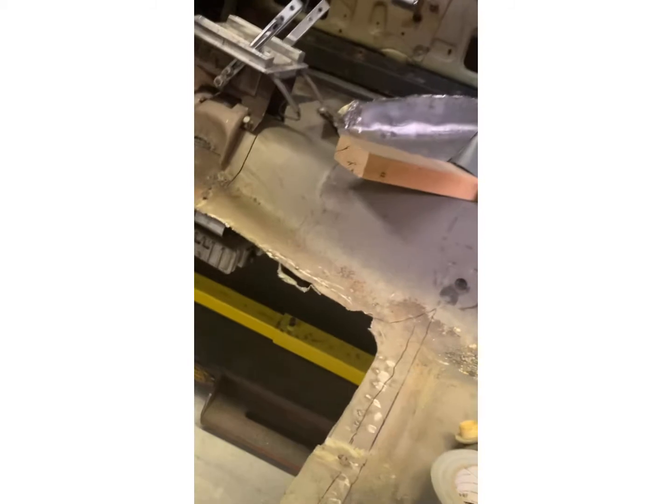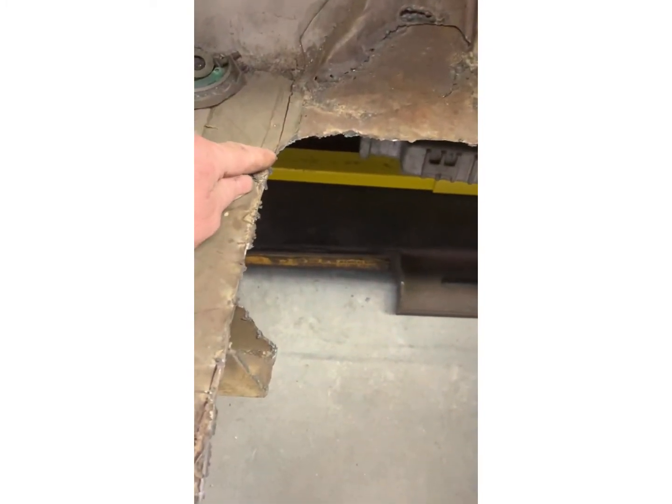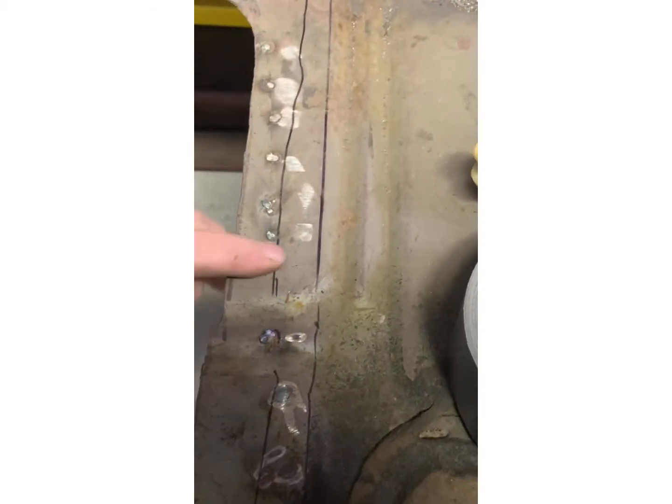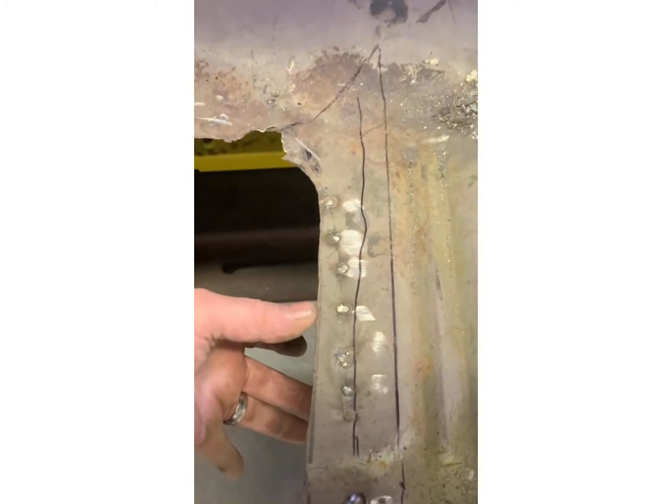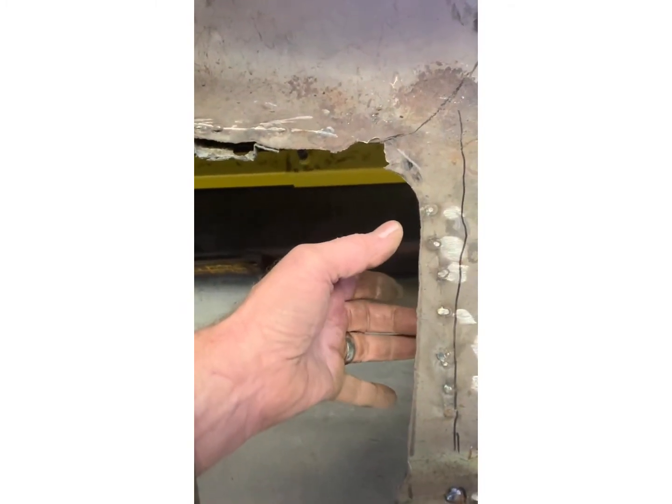Alright, today we're going to work on this floor pan. As you can see, there's a big hole in there — it's just kind of roughed in, I got some lines there. What I'm going to do is straighten this out all the way across and then cut it off straight. From here to there, all this will be bent down. This can be cleaned up, bent on this line. I have to have six inches in the front so I can set my seat in here and be able to work it.